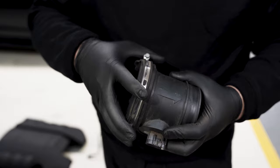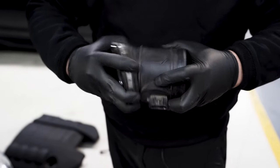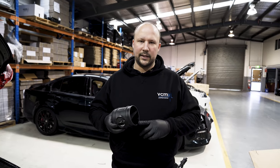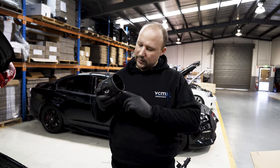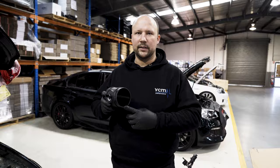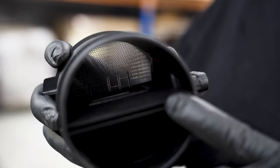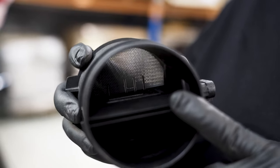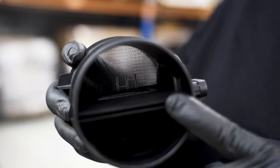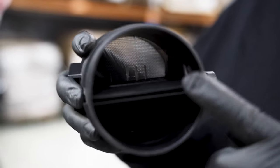Remove the rubber reducer off the actual MAF because you won't need to reuse that. One important thing is that you need to clean the resistor in the MAF because they can get quite dirty and give you false readings. Always use a good quality MAF cleaner to clean the diode — don't use brake cleaner or carby clean because you can damage them. Make sure you don't touch them with anything or use air pressure that's too high because they are quite fragile.